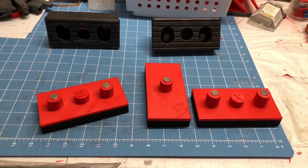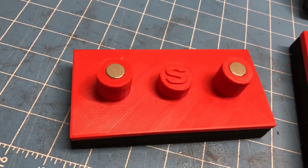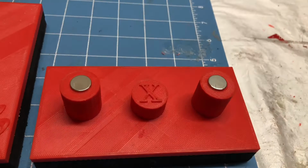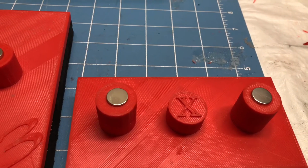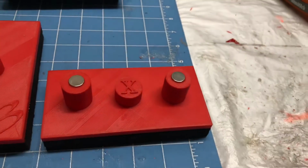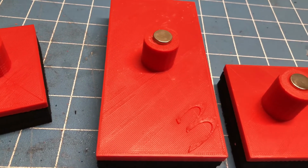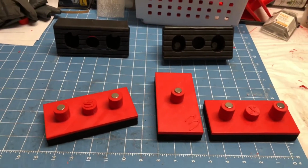Always make sure that your suspension is set correctly. Your Model S suspension needs to be set at its highest level and then jack mode. Your Model X needs to be set at the low level. Of course, depending on your floor jack, it might have to be not at the complete lowest, but the second lowest, and then set it in jack mode. The Model 3, as of yet, does not have the air suspension. It's a straight strut, so there's no suspension or jack mode to set on your primary screen.